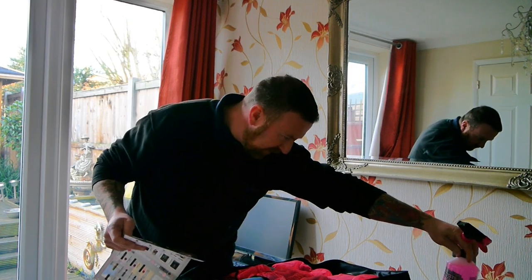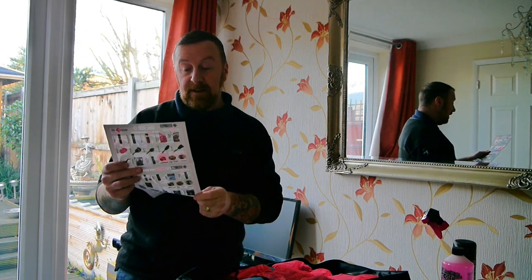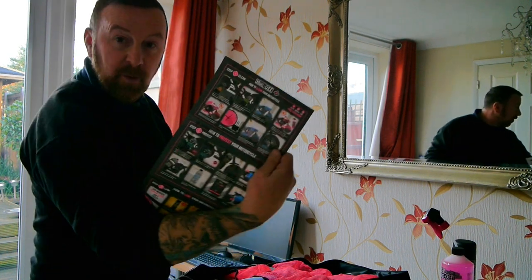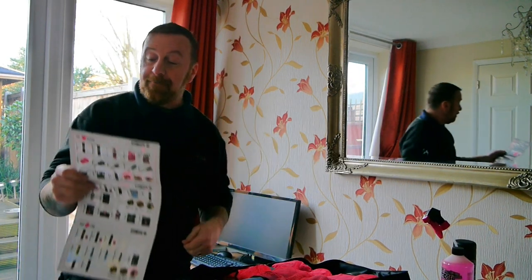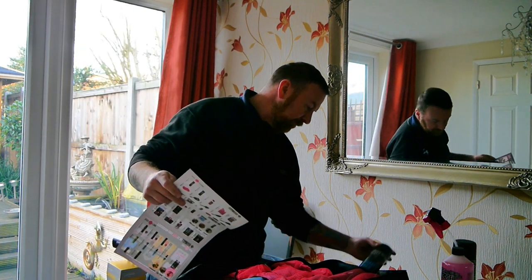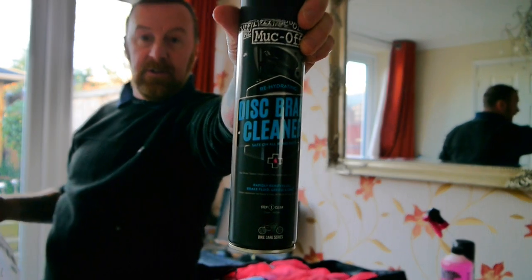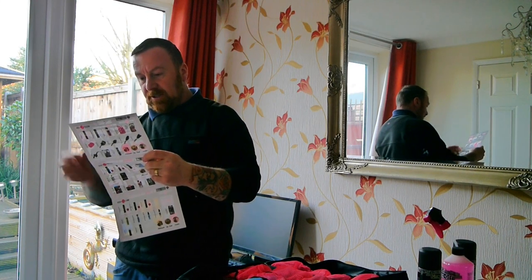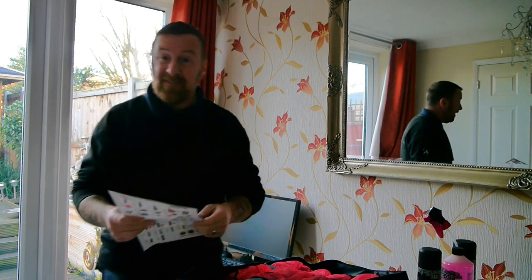That's a good litre or maybe litre and a half bottle. Then it says agitate extra areas with a brush - good scrubbing. Then rinse that off. Next is the disc brake cleaner - nice and easy, 400ml. You spray that all over your disc brakes and pads, then wipe away any excess with a cloth. That's it - should be lovely and clean.